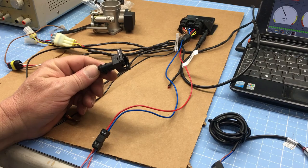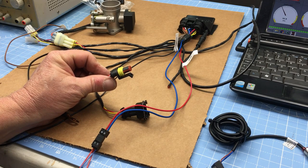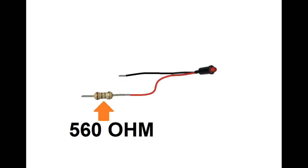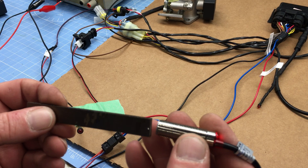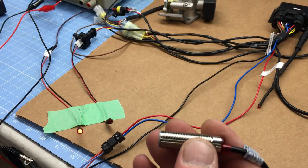Now that we know the ECM can see the crank position sensor signal, we need to verify fuel pump and injector operation. We can't run a pump or injector dry, and testing with gasoline is an even worse idea, so instead we'll use LEDs as substitutes. These LEDs will fry at 12 volts, so we need a current-limiting resistor — a 560-ohm resistor is adequate. LEDs are polarized so connect positive to positive and ground to ground; wrong polarity won't damage anything, the LEDs just won't work. Waving the magnet in front of the sensor should turn on the fuel pump LED and cause the injector LED to flash — and that's exactly what we see.